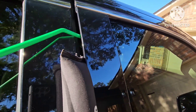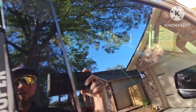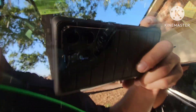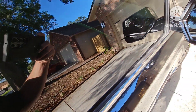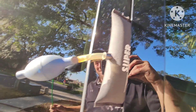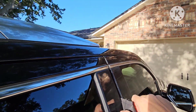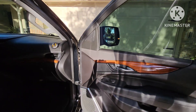Just take the reach tool with the rubber tip and slide it through your door frame like so. Once you get the tool inside the vehicle, come over to the door handle. Hook the inside door handle, rotate the tool, hook it, and pull. Then pull the tools back out, deflate the bag so the door goes back in, pull the bag out, and open the door. There we go.